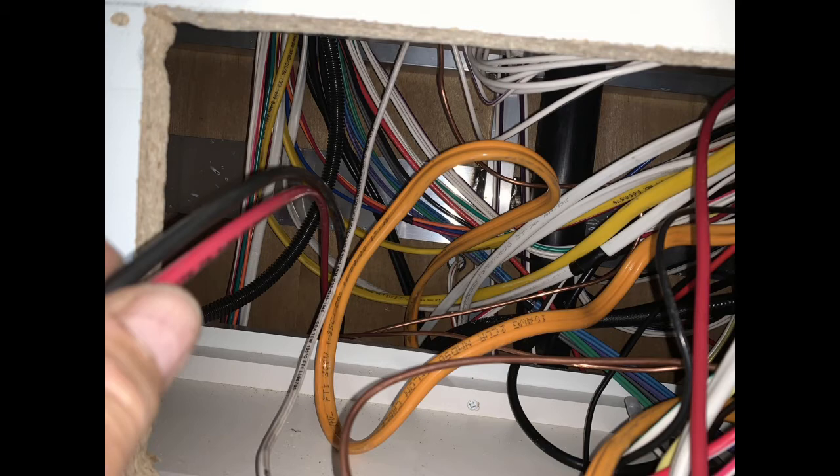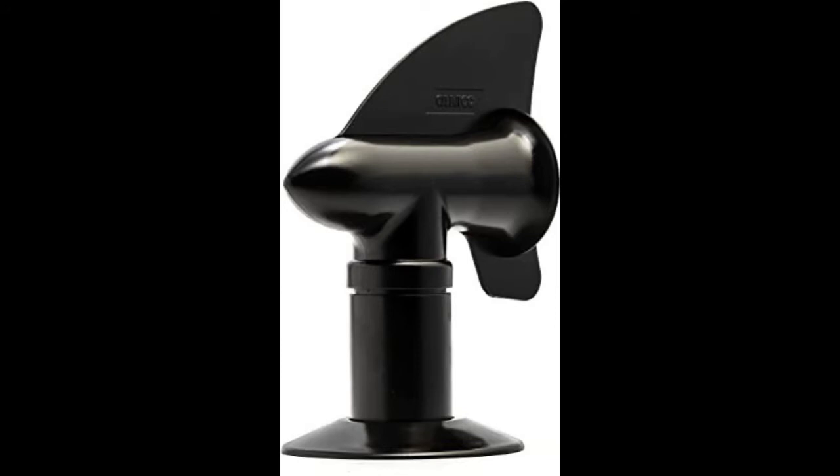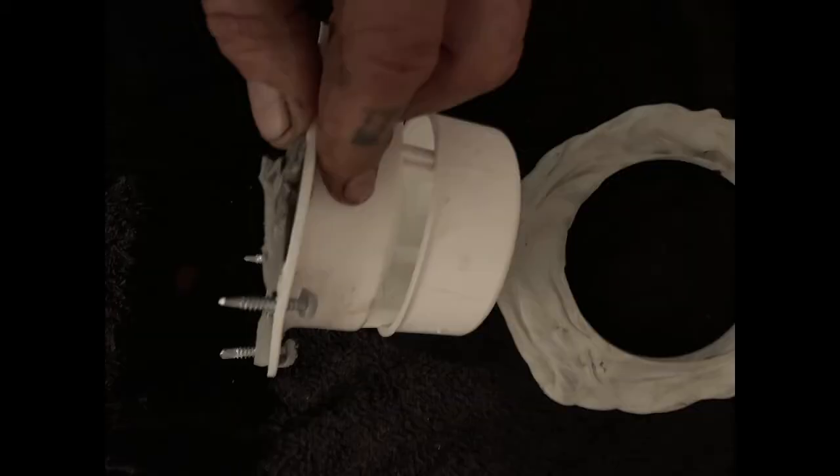From the lower wiring into my cabinet — wiring down the vent pipe area — you can just drill holes or notch and remove the vent cover. I suggest the Camco Cyclone vents — probably the greatest thing you can do to reduce black tank smells. At the bottom of that base plate you can easily take your Dremel or drill, run your wires right down, do your Cyclone installation, and seal with Dicor, GE silicone caulk, making sure it's 100% watertight.